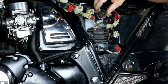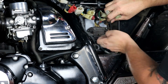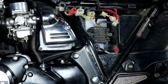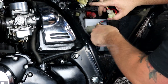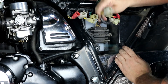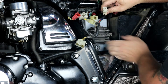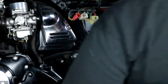I'll remove the left bracket and remove the nut for the right side. Our turn signal relay is attached so I'll just set it up here. You also want to make sure right on the other side of the battery is the stator connector side of the regulator — I've already unplugged it and fished it through the hole there. Make sure you do that so it's loose. And here's our second plug for the ignition switch and battery power side. Now I can slide off the old one and set it out of the way.